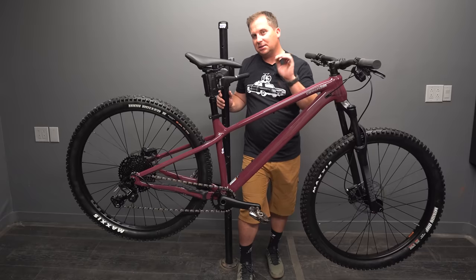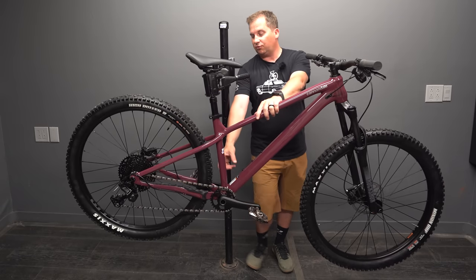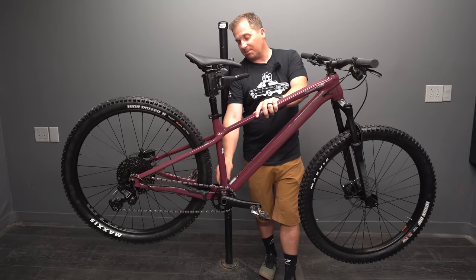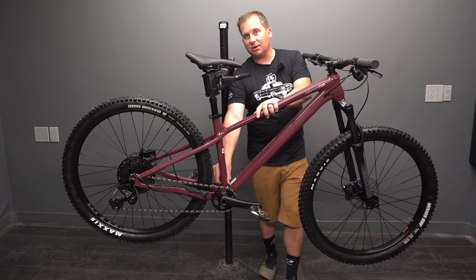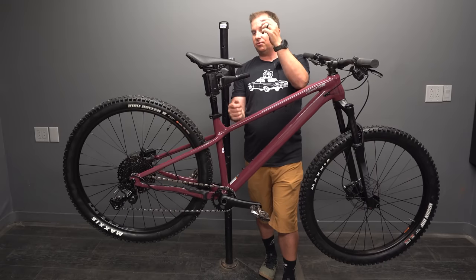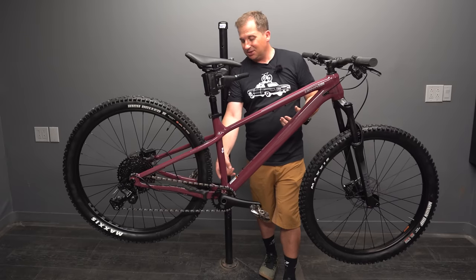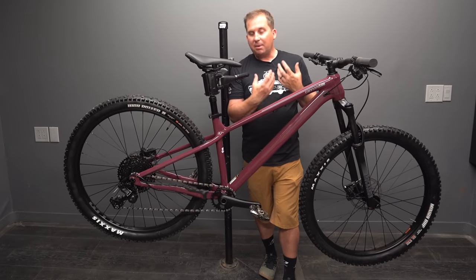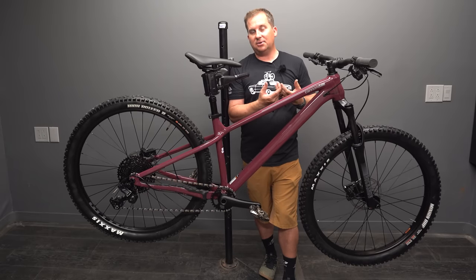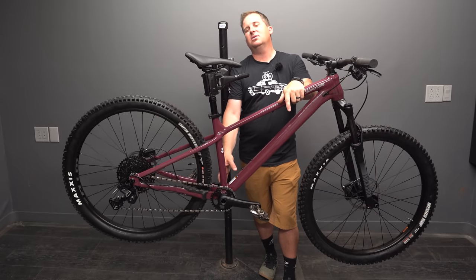One other thing that needs to die, and I'm being particularly critical, these little rubber grommet plugs for the droppers, they need to go away. We need to never see those again. They just wear out over time, and especially if you're raising or lowering your dropper, you let a buddy borrow your bike, you need to raise it an inch, they just have a lot of friction. They end up tearing. They're a pain to work on, and there's better solutions. We've got to get rid of those. They're not the right solution. And so every time I see those, I'm just like, no, why?